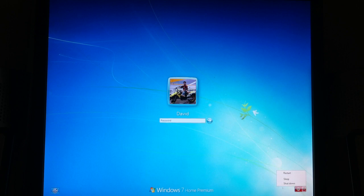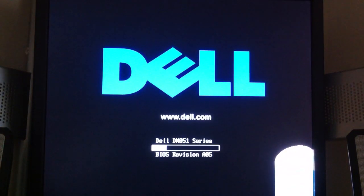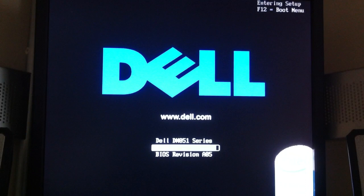So you're going to turn on your computer, go down here and hit restart. Once it does that, you'll see your computer restart. And then once it boots back up, you're going to hit F2 very quickly and you'll see it up in the right-hand corner — it'll say 'entering setup'.